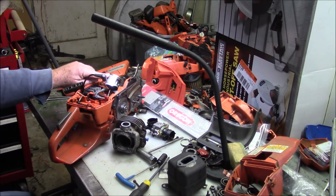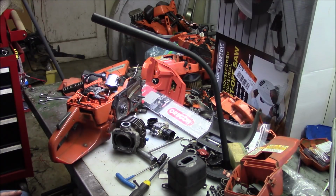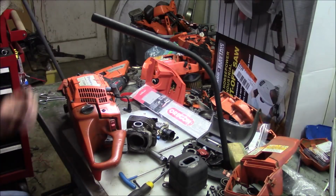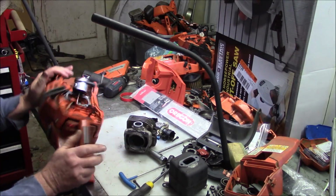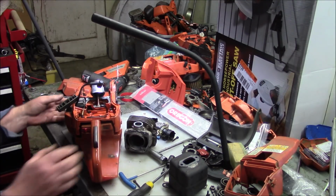It's got the single ring 371 piston. It's got a no base gasket build, and it actually got traded in for a new saw, running fine, and I ended up with it for cheap because I was looking for a bottom end to build a big bore, and lo and behold, it's something that I probably built, I'm going to guess, 8-9 years ago.